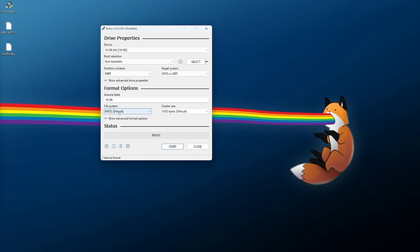It doesn't matter which way you do the two installs — one through XMB and one through Safe Mode, or both through XMB, or both through Safe Mode. Two good installs of HFW are recommended to minimize install errors and mainly to get ROS0 and ROS1 on the internal firmware matching. Once Safe Mode installation is complete your system will reboot, and you'll need to adjust your audio-video output settings before continuing.